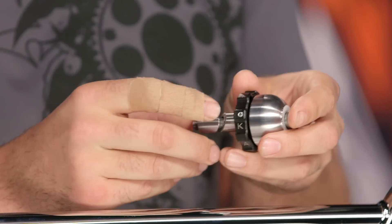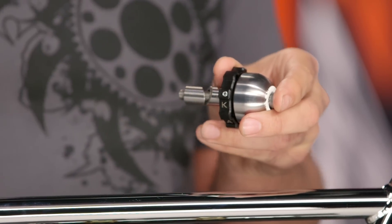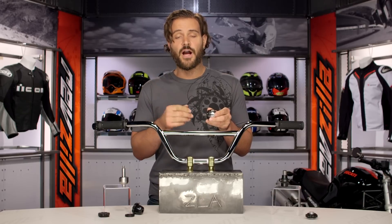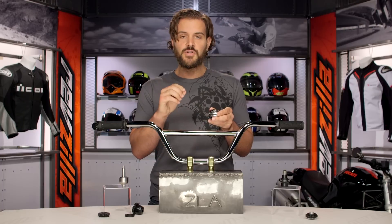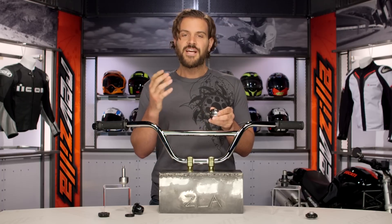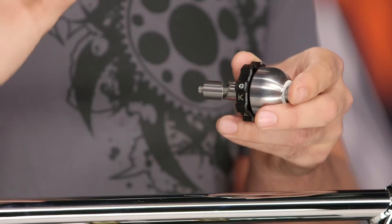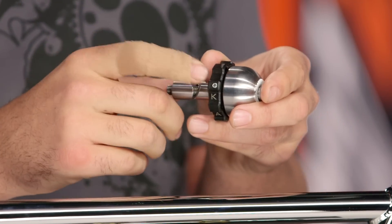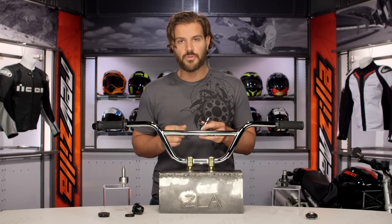The other thing you're going to notice is there's a little set grub screw. Out of the box, you're going to be able to put this on, install it, and go out and ride. Over time, however, it will need slight adjustment — you need to make very small turns to that grub screw if you notice your throttle lock is slowly loosening up and disengaging without you twisting backwards. This grub screw is really the only adjustment you're going to have to make on your Kaoko throttle lock.